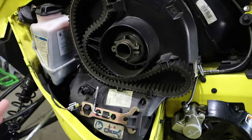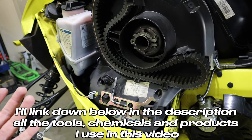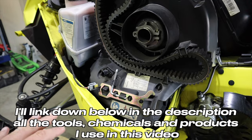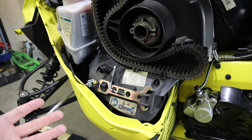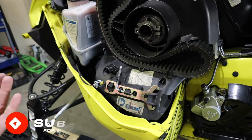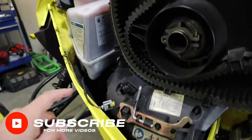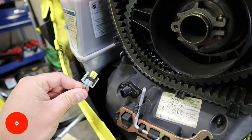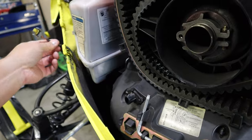So can you do this while it's on the sled? Yes, you can. Definitely doable. In fact, I already did one bearing while it was on the sled, but I want to show you guys how to go ahead and remove it if you need to. The clutch puller is like — I think I paid like 28 bucks on Amazon for it — fairly inexpensive. So the first thing in order to remove your clutch, we're going to disconnect our temp sensor for the clutch.